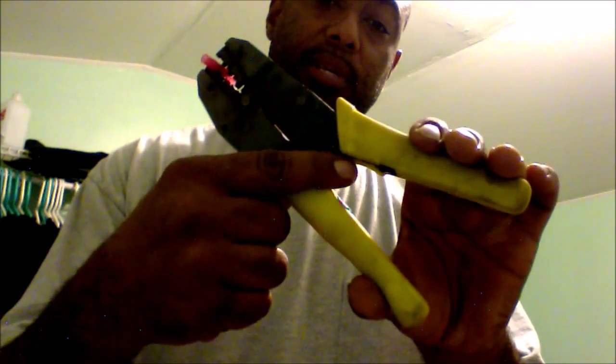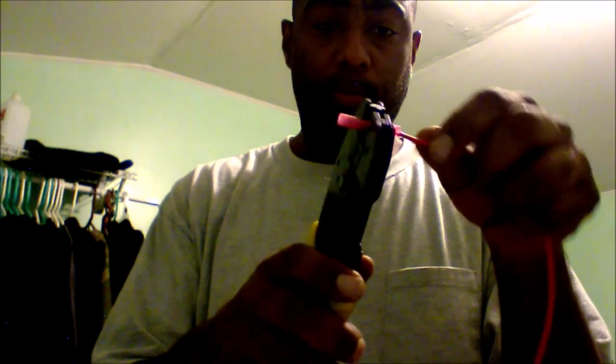And there is a locking mechanism in the middle so that you can release the crimp, so you don't have to go all the way through it. But I got the crimp in one time to set it. Now go to our prepared wire and put the crimp in. Put the wire in the splice, and now we are going to crimp.